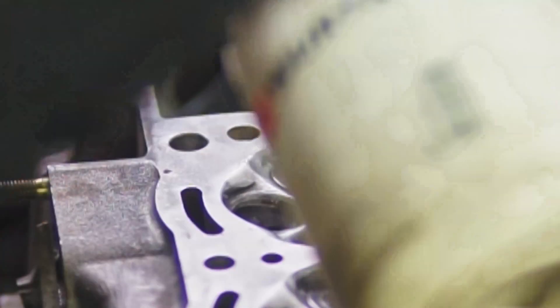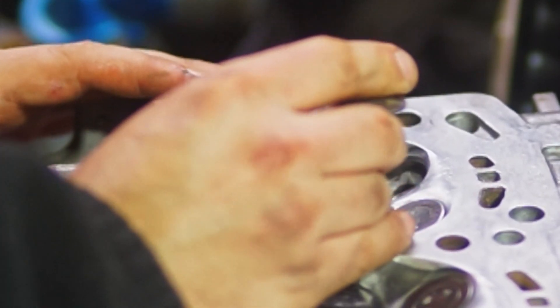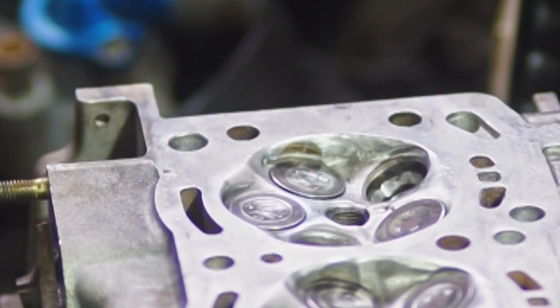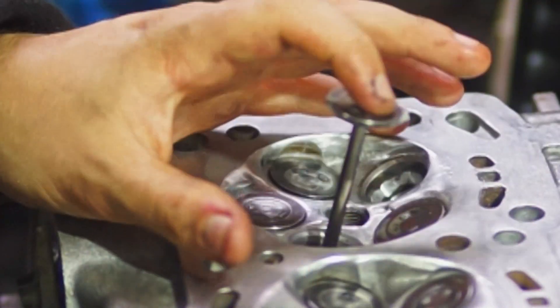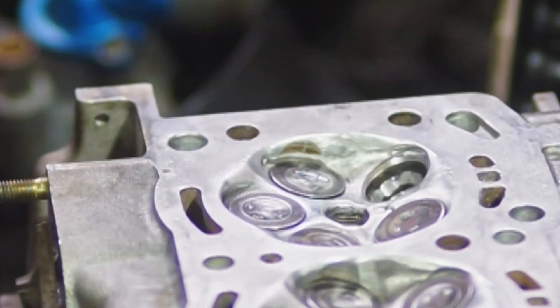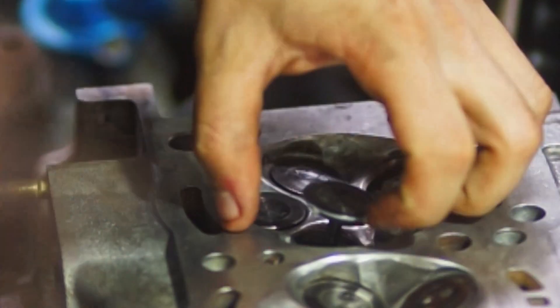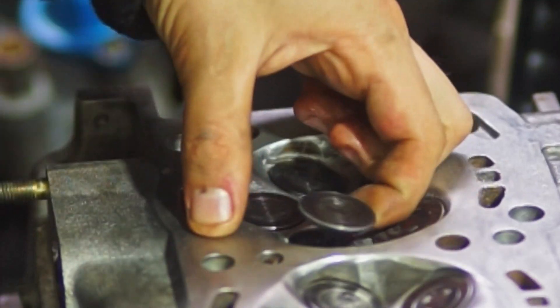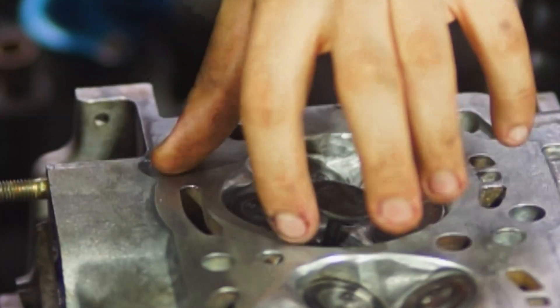Put the compound back on the seating surface and grind again — three to four, maybe five times depending on how the seats look. If they are a bit more worn or have a lot of pitting, you may need more passes. Just make sure your valve shaft is lubed up so it turns freely in the valve guide, and make sure no excess valve grinding compound enters the valve guide, as that can cause heavy wear.